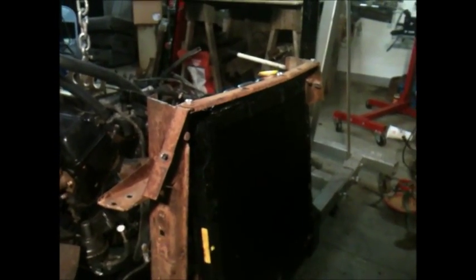I'm going to go ahead and put the motor mounts on here that I built over a year ago, set the motor down in here, and get an idea of where the fan will ride in relationship to the radiator. I'm going to kick the bottom of the radiator out about two inches so that it doesn't stick up past where the old one did — it'll look a lot nicer, and once you've got the grill on you'll never be able to tell that it's kicked out. A lot of guys do this and reuse their original radiators in this location with an S10 chassis because they have to kick it out because of the steering box. I think that might be the easiest approach and it'll look better in the long run, so I'll have to make some brackets.